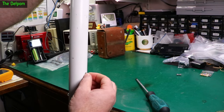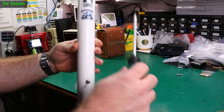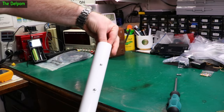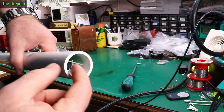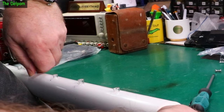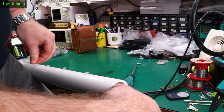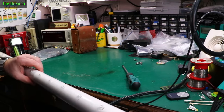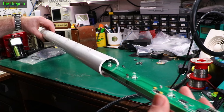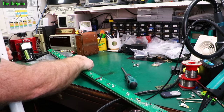I've already got the other ones out. You've got to take them all the way out. Sometimes they screw into the plastic and you can just leave them sitting there, but sometimes they do fall out — if they do, watch out because there's a washer on them, don't lose that. To get the circuit board out you kind of have to turn it a little bit. Just slide it out nice and gently. If it does catch, you'll know about it — you don't want to be catching it, so do it gently. There's the circuit board out.